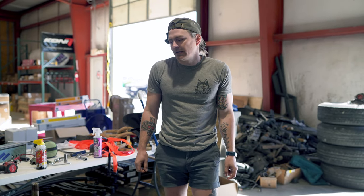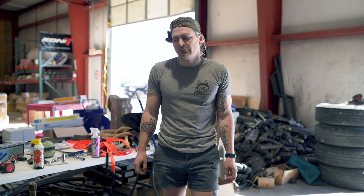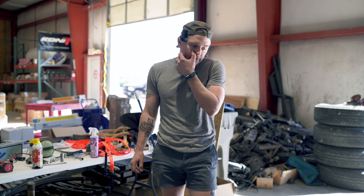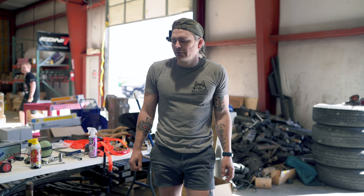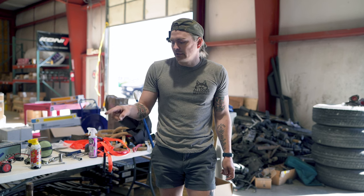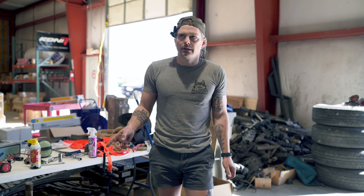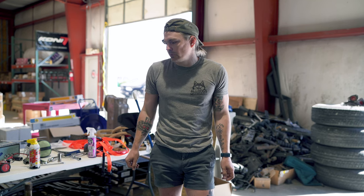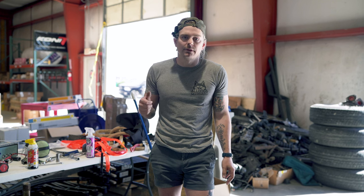What's up guys, this is Chad at All Dogs Off-Road. Today we're doing a video on an M226 rear axle rebuild. The shop Xterra has a C200K in it with 3.13 gearing. We're going to switch the Xterra over to this M226, which has 3.36 gears and also has an e-locker. This is a factory option in the Pro 4X and the older Xterra Off-Road trims — it's a bit beefier and stronger.